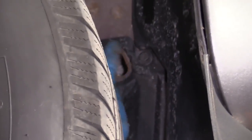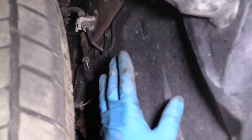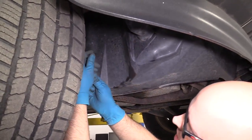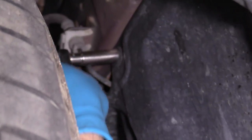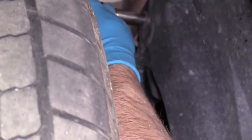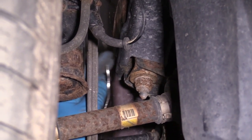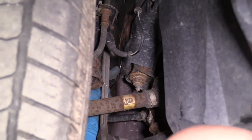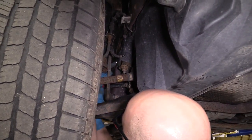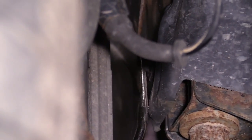I'm going to remove this bolt as well. To make it easier, I'm going to remove this whole piece — it's not completely necessary, but it will be a lot easier, so I'll remove this bolt as well. Then there's a push clip on the backside over here. It would be easier if you had the tire off, but it's not impossible with the tire on. Grab the trim tool and pull this clip out.